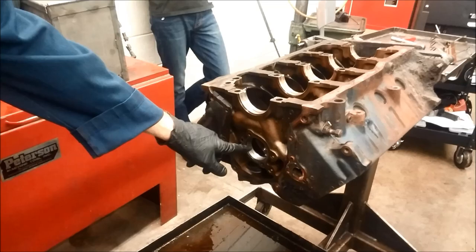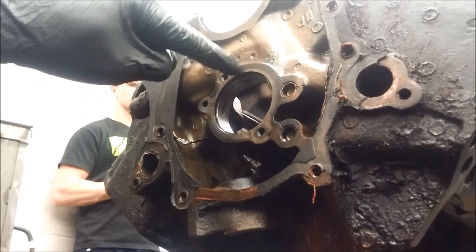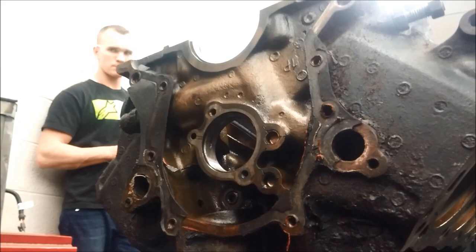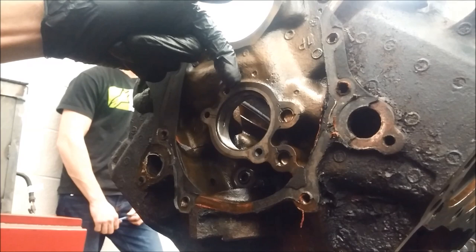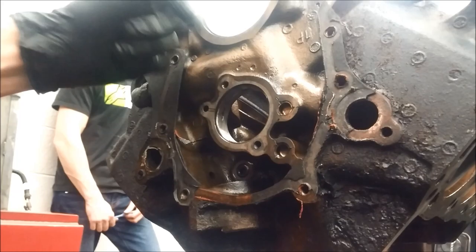The first step is to get down and look at the bearings and take very careful note as to where the oil holes are. You'll notice that this bearing has two oil holes — one up here and one down here — and a groove. It's good to take a picture of that or mark it. The next bearing in only has one hole. You need to make very careful notes of where those holes are because they need to line up with the oil holes that are in the block, so as oil passes through the block it can pass through the hole and oil the camshaft. If you later install those bearings off-centered a little bit, no oil will be able to make it to the camshaft bearings.